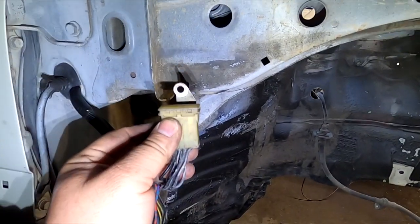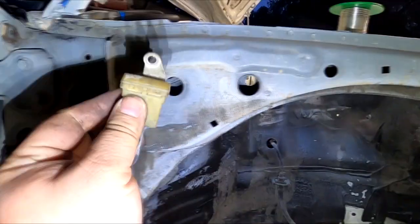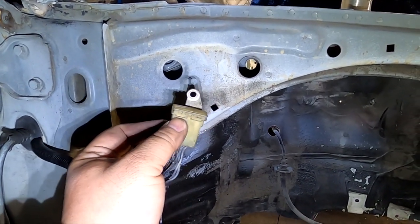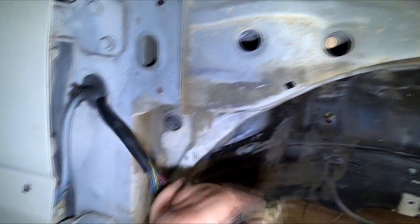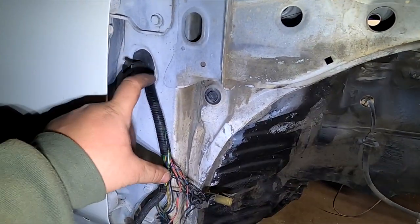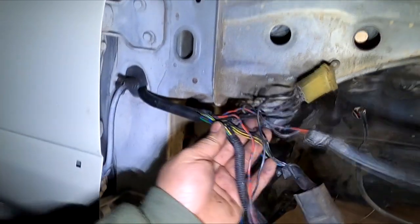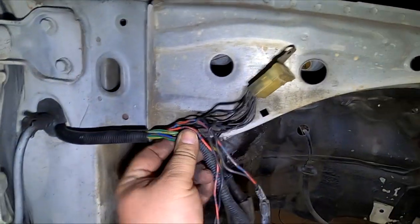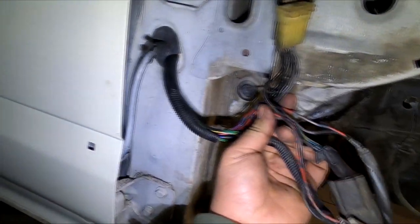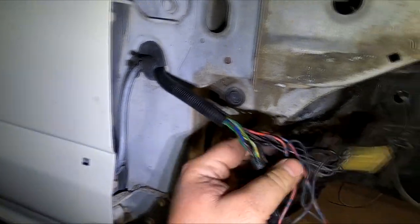And you can use a self-tapping screw, you can use a bolt and nut. I've used self-tapping screws without issue. Just got to go really slow so you're not hollowing out the hole by going super quick. And typically what I do is I pretty much go the length of the excess wire coming out of the frame here. So that's probably going to put my ground somewhere here, right? Just to keep this slack from just slacking, I guess.